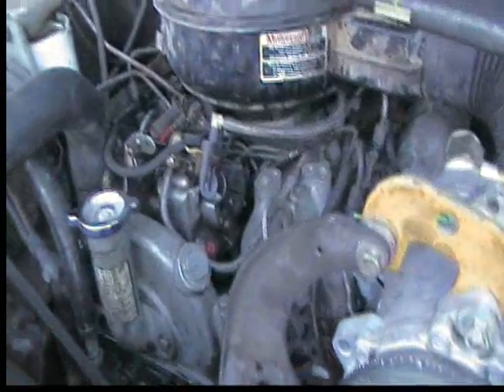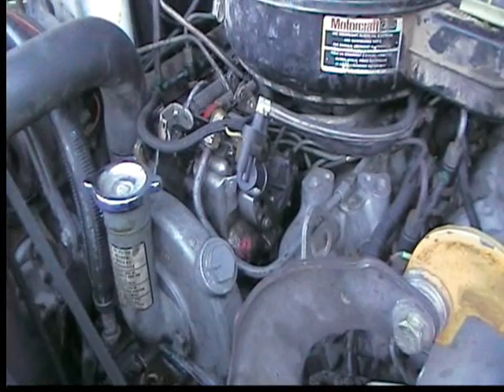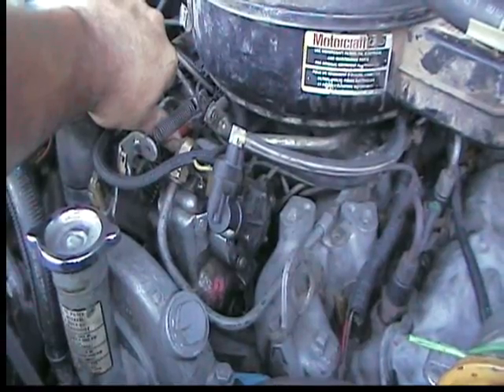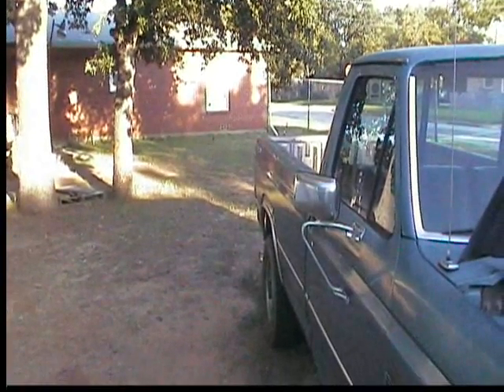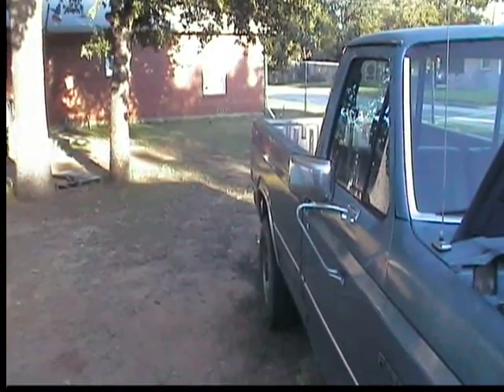The verdict is it runs like it's ours. What we ended up doing is putting a new injection pump in it, and as you can see it's running real, real nice now. Doesn't miss or nothing, doesn't smoke, runs real good. As you can see, the exhaust pipe — there's nothing coming out. So if you think it's your injection pump, or if it's smoking a lot and you think it's something else, process of elimination, and then the injection pump last — but it could be the injection pump.